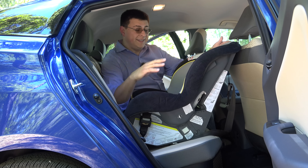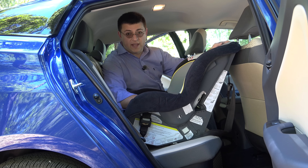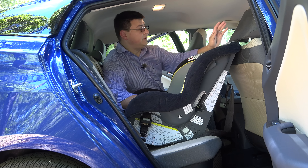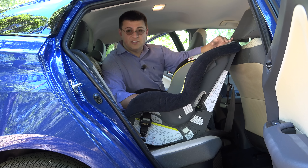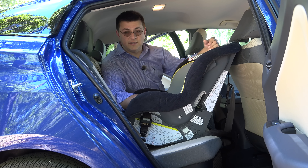With the front seat in that position, it is a little bit of a tight fit to put a rearward facing child seat at the proper angle in the back seat. If you could move the front seat up about an inch further, or tilt the backrest up just a little bit further, it would be possible to install this at the proper and safe angle. Make sure that you have an inch to two inches of room between the front seat and the child seat itself, because in the event of an accident, the front seat can actually impact the child seat.